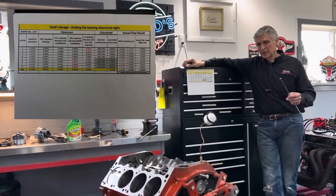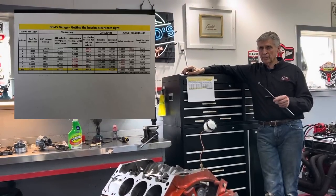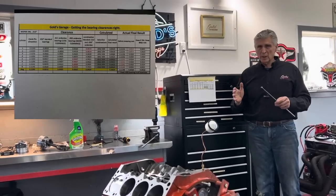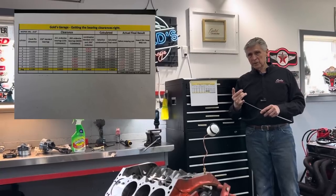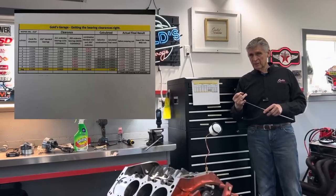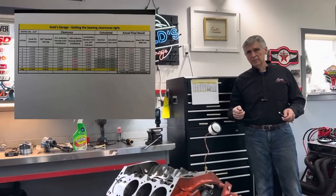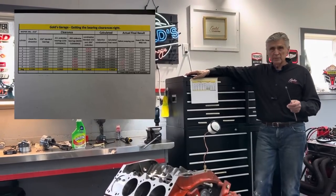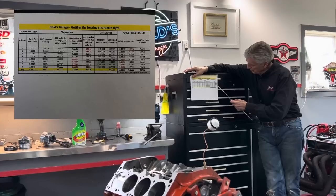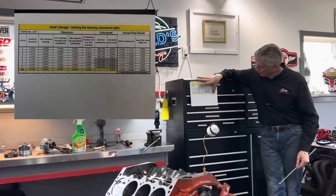After a lot of measuring and trial and error, what I ended up doing was swapping connecting rods — I swapped number one with number seven, and number two with number eight. Even though it's the same size bearing, just because of the way tolerances work — plus or minus a tenth of a thou — we're only talking small numbers here. For reference, a human hair is about four thousandths of an inch, so we're talking a tenth of a thou. That swapping gave me clearances of 0.0020, 0.0022, 0.0020, and 0.0024.